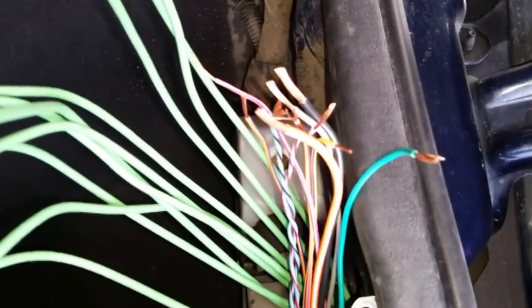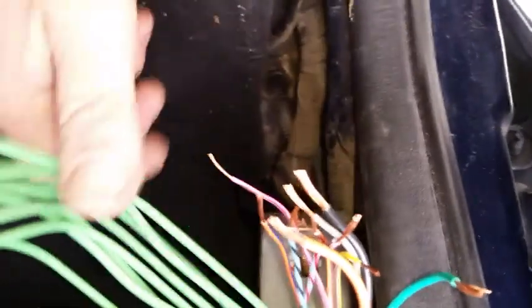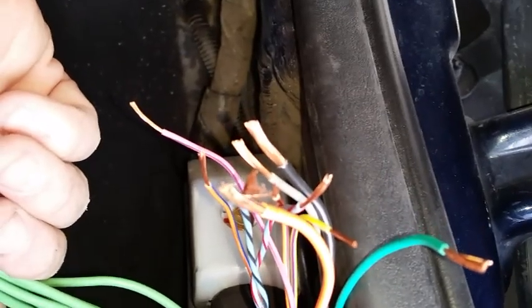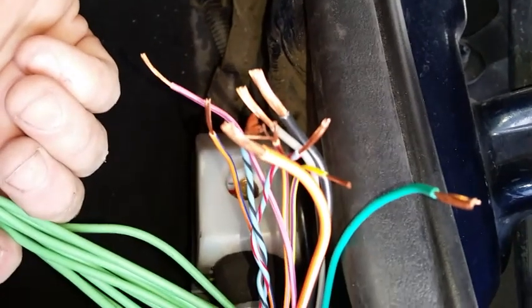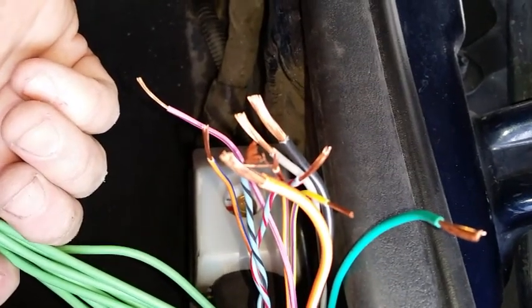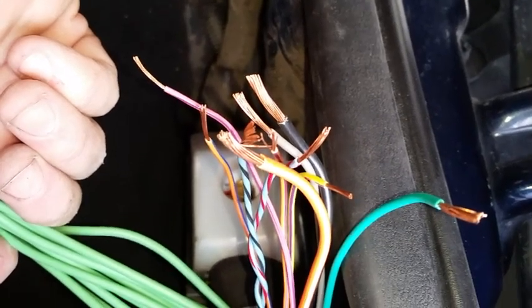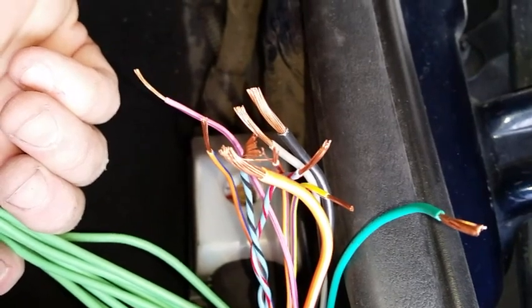Oh, and just a note, Jeep, in these original wires, there's 12 gauge, 14 gauge, 16 gauge, 18 gauge, and 20 gauge. So I hope the engineer who came up with this copper saving technique of probably using the exact minimum size wire available for each circuit got some award, because it's kind of a ridiculous thing that goes along with many automobiles. Really, it should be something like: anything that requires a 20 gauge, 18 gauge, or 16 gauge, just use 16 gauge. If it requires 14, 12, or 10, use 10. Or maybe 12 and 14, use 12, and 10 is separate, that's pretty heavy wire. But this, come on, guys.